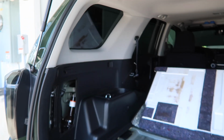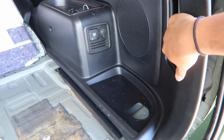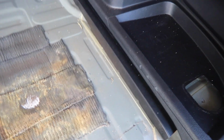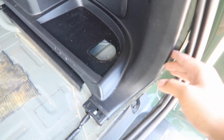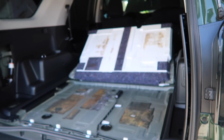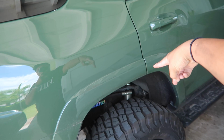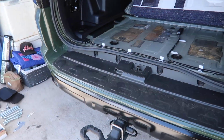And your interior for your trunk, which is pretty much gotta loosen up these panels. Gotta pop off this thing right here, and that has a bolt. Bolt right there, I think here. So we can get to that guy right there. So pretty much there should be a total of 8 body mounts. 2 in the front, 2 like second front, mid front, whatever. 2 to the cab part under the rear seats, and 2 right at the very back.